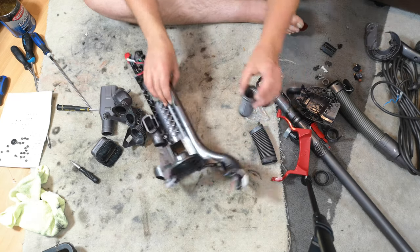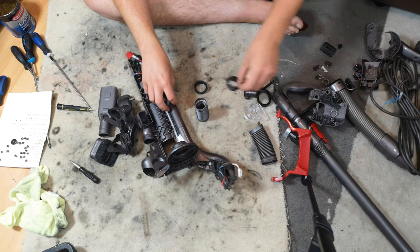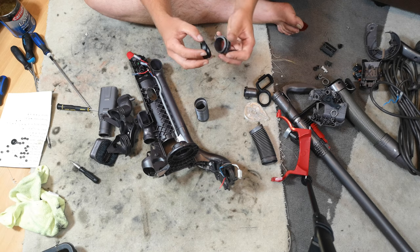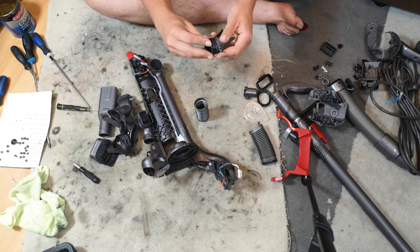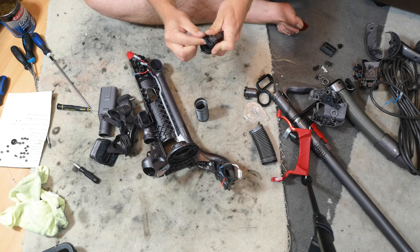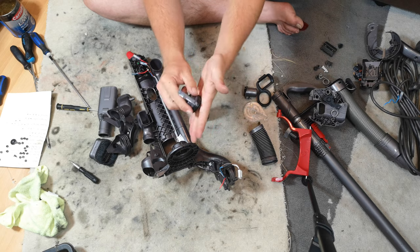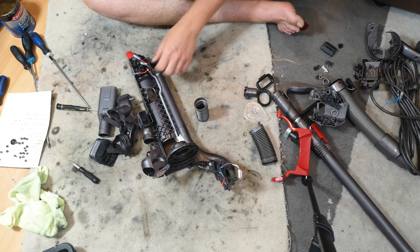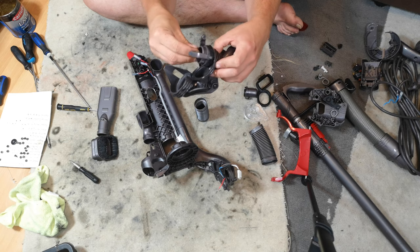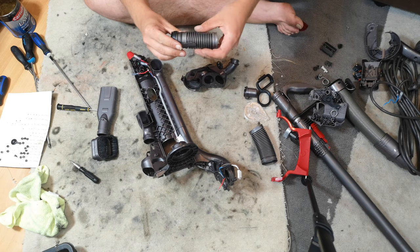Next up is this little hose, this little seal, this little thing, and that's it actually. This is the changeover valve for the suction. So obviously when you move the machine, this valve moves with it. The first thing to do is to put its seal on. So obviously when it moves, this thing just goes all day long. Then we push the hose on.